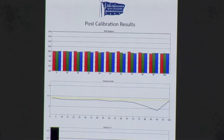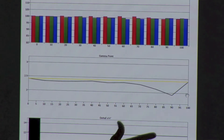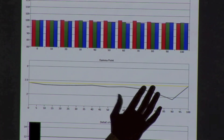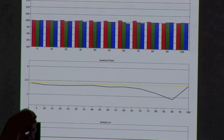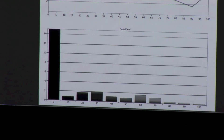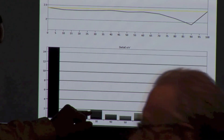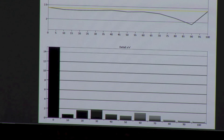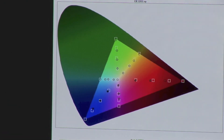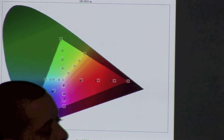This is the Samsung LCD. It could not reach the 2.4 gamma, as we can see, and it has a dip here at 90%, which means that with bright objects or bright detail it's a little bit overexposed — close to full white. We maybe could have gotten it better, but we would have had to screw up the grayscale. It's a trade-off — better to have a dip there than a dip down here, because all your shadow detail gets ruined. Errors are still below 2, mostly across the board — most are actually at 1.5 or below. The saturation sweep shows it's good, not perfect — a little off over here, maybe a little bit saturated in red. Everybody sees that problem in the red area.